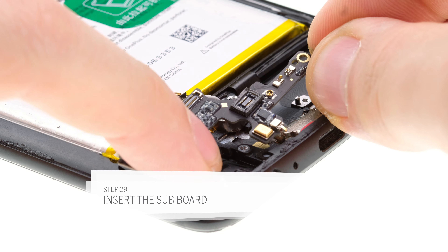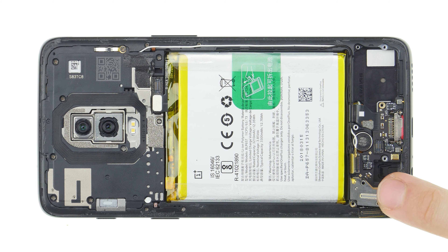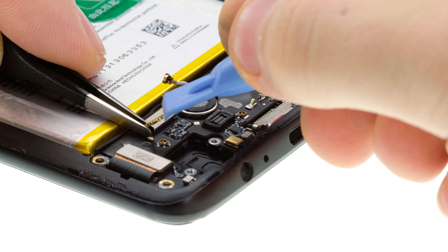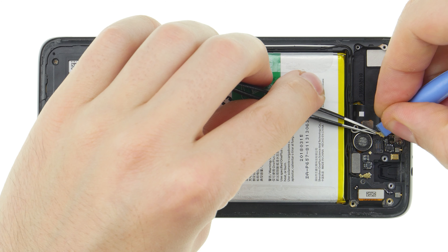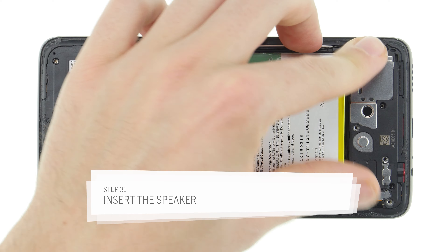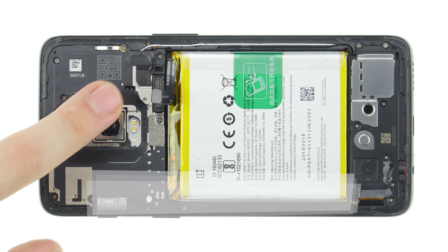Place the sub board in its place. Make sure that it sits correctly on all sides. The small openings of the board are directly above the pins in the device. Place the plug of the display cable on the board. The round opening helps with positioning. Connect the display connector and the cable to the main board. Use a pair of tweezers to help connect the antenna connectors. Position the connectors directly over their socket and carefully press them tight with a spudger. Make sure that the antenna cables are in the correct positions. Put the headphone jack in place. The golden pin must be passed through the opening. Press the jack down firmly and attach the connector. Place the speaker on the lower edge and press it down until it sits properly. Fasten the speaker with the Phillips screws. Connect the battery to the main board.